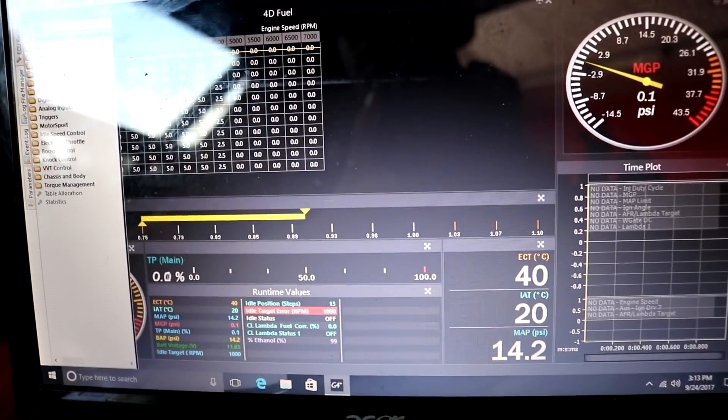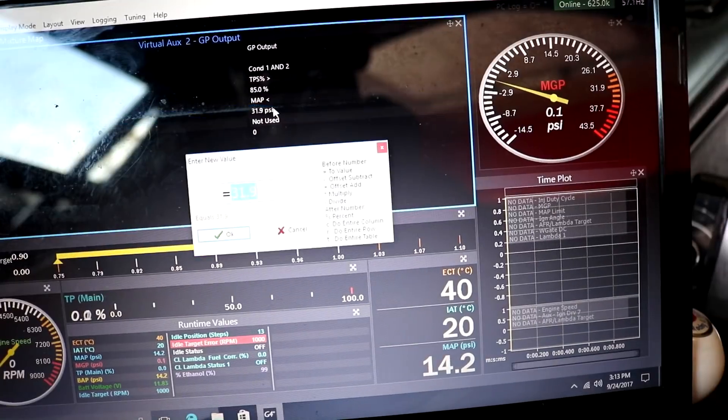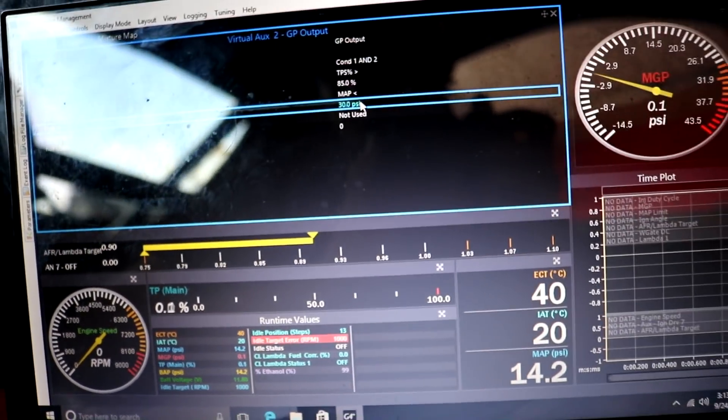What I need to do is change when my nitrous shuts off — I should change this to 30, because you have to add one bar for atmospheric pressure, so it should shut off at 15 pounds. I'll do a log and bring it up to show you guys what I know. I'm not a tuner by any means, but I can show the simple things I change at the track to get off the line and down the track without spinning.